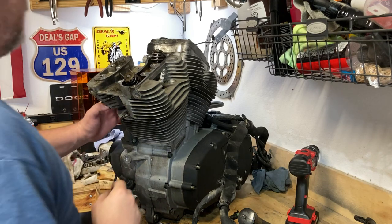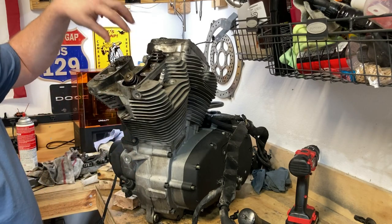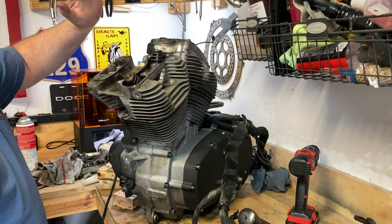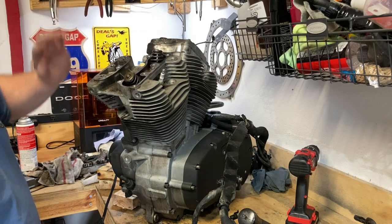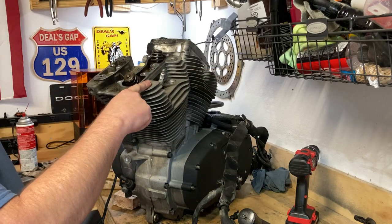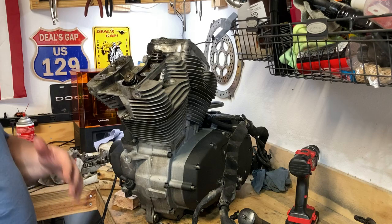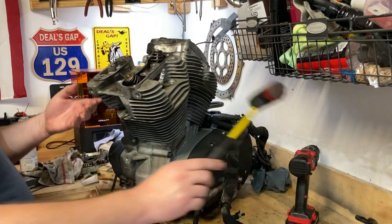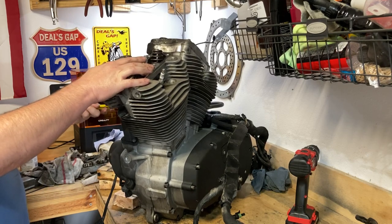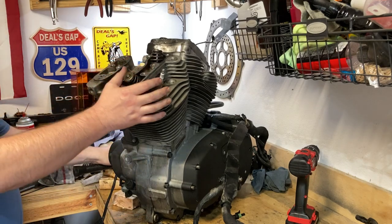The push rod covers come off later, so there are some O-rings here. The Buell shop manual does say to remove the bolts in sequence — it's one, two, three, four. I'm pretty sure I did it out of that sequence. The warning is that if you remove it out of sequence, you stand the chance of causing some warpage in the surfaces — that's if you don't plan to machine the head and potentially your cylinder. I am machining all this stuff. I'm going to secure the head with my hand. Okay, I can see the head move, so it should come off. There we go.